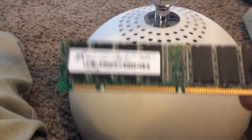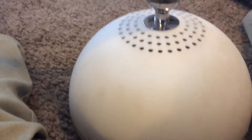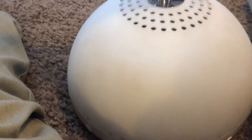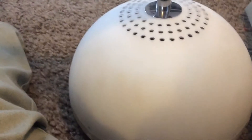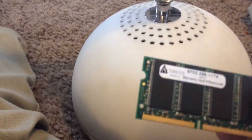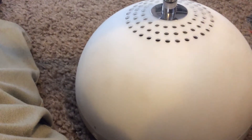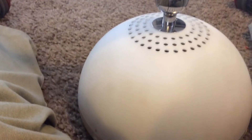What you should be left with is the original 256 megabyte stick that this computer originally came with in 2001, and whatever RAM you had in that user accessible slot. In my case, I had a 256 megabyte PC133 DIMM piece of RAM. You might not have any, you might have more, you might have less. Most likely if you have anything in that slot it would be 256 megabytes, but you could have a 512 megabyte.